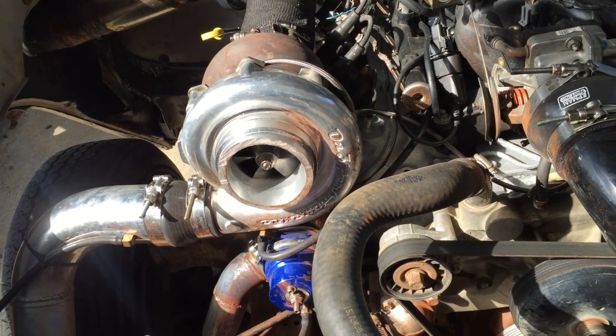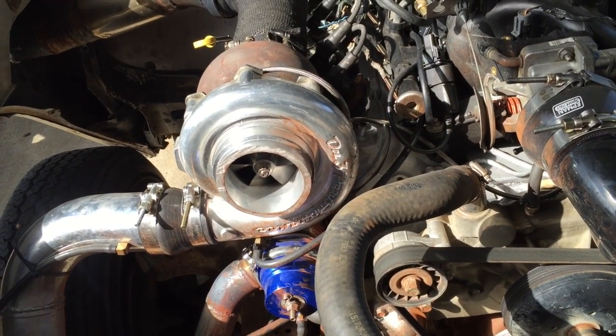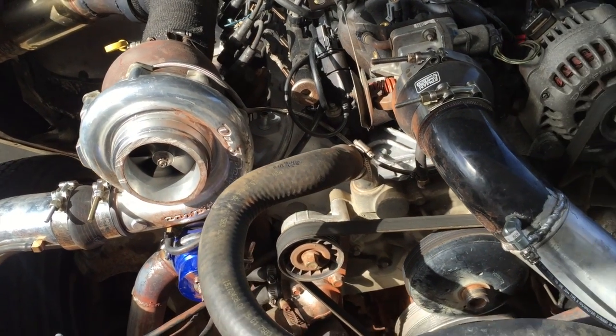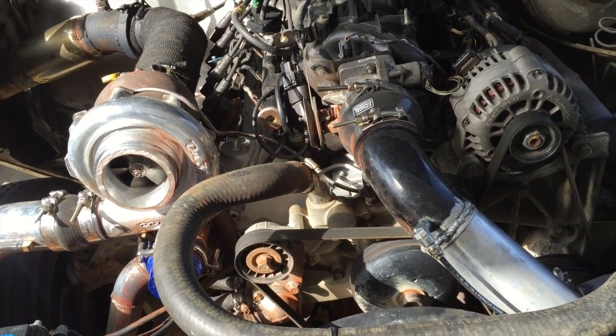So next morning, go to the track, go to make a pass. It's fat, like crazy fat. Don't know why. Take 10% out. Runs like a 13. Make another pass, cleans up a little bit, take another 10% out. It's fat.